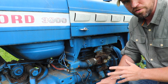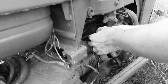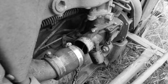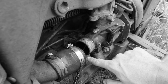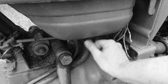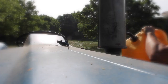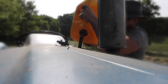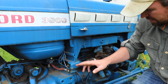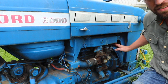In order to figure out what's going on with our fuel system, we first have to understand how the fuel system operates. When the fuel is leaking out like this, it's important to recognize that there is a way to cut the fuel off. With the engine off, the fuel was still spewing out. Underneath the gas tank, there is a shutoff valve which will shut the fuel line off. That's where we can start with how our fuel system operates. Fuel for this tractor goes into the tank, and at the bottom of the tank we have the gas line leading out with the shutoff valve. The gas line then travels through this area of the tractor and shoots on back to the other side.